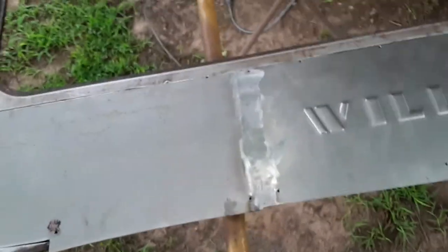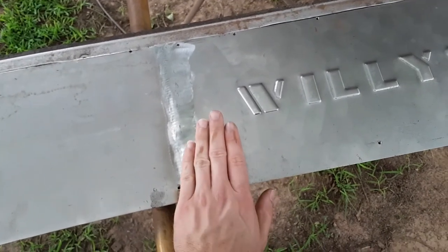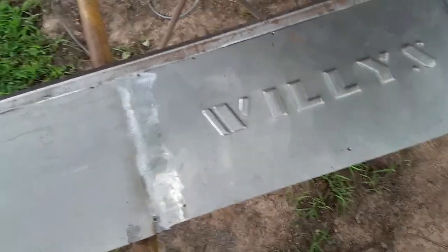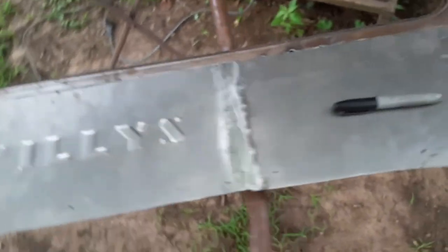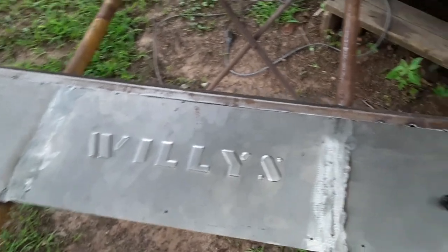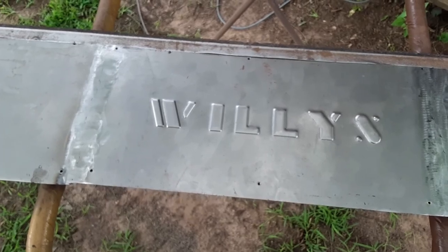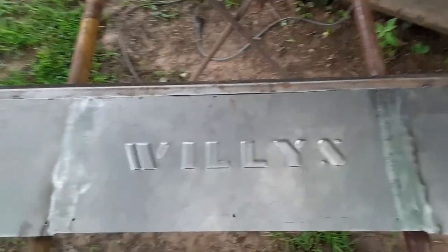Especially in this middle section because it has to fold over — it'll just bend this up before it folds. So with the spot welds all the way across, it'll roll under a lot better. And I'm definitely going to have to roll it under because of that edge right there. So I'm going to get started drilling all the spot welds, grind the back side, get my line-up screws back in, and I'll be ready to weld it in.